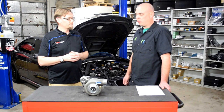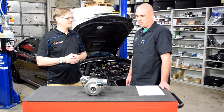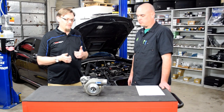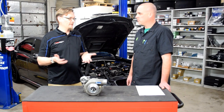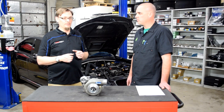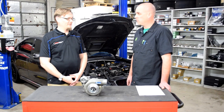It was ready to take more. Harvey didn't want to go over 20 pounds of boost, which is probably wise with the stock head studs. But if you upgrade to ARPs and a forged piston on the bottom end, it's definitely ready for more. My takeaway of this turbo is that it's a small, quick-spooling turbo — if you want something that maximizes the potential of the stock engine you've got it, but if you've got a mild build and you're not looking for over 350 horsepower but really want something that comes on quick and you can run a lot of boost on E85 and make a lot of torque, this seems to be just about as ideal a turbo as we can find.